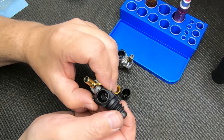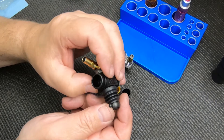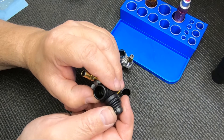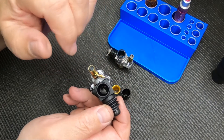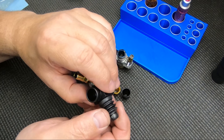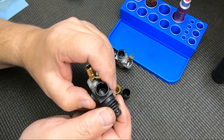If you just come off the corner and pull wide open throttle right away, your fuel mileage is going to suffer and you kind of overload the engine with air. It's best to just roll on the throttle — ease into it. You'll get less tire spin and your mileage will improve. If you're struggling with a short run-up double off a corner, try just rolling on the throttle and you'll be amazed how much farther you can jump using a little less throttle. It does take some time to get used to, because you want to just pull the trigger.